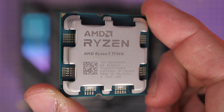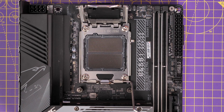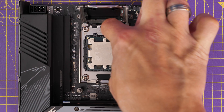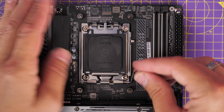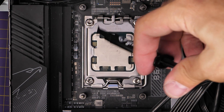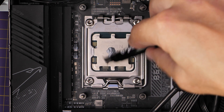Hello, this is the Provoked Prawn. If you've got yourself an AMD Ryzen processor with an AM5 design — that's not only terrifying because you might damage the pins on your motherboard, but also because it has a heat spreader with several notches in it — then you may well have had a problem. If you're like me and you're a bit generous with thermal paste, maybe overly so, you may be concerned about those notches causing problems with seepage.